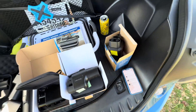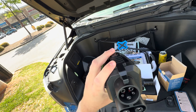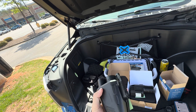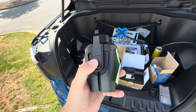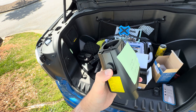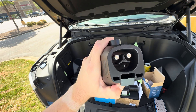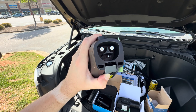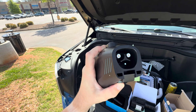The Quale adapter at $120 is also pretty bad. The S3 CCS latch works but feels questionable, and the design encourages improper use. The NACS latch has no switch on it — you can just open it and hot-unplug it. There's no interlock or shutdown trigger on that latch. It may as well basically not have a latch. I genuinely don't understand how these companies can make such blatantly dangerous products and decide to sell them.